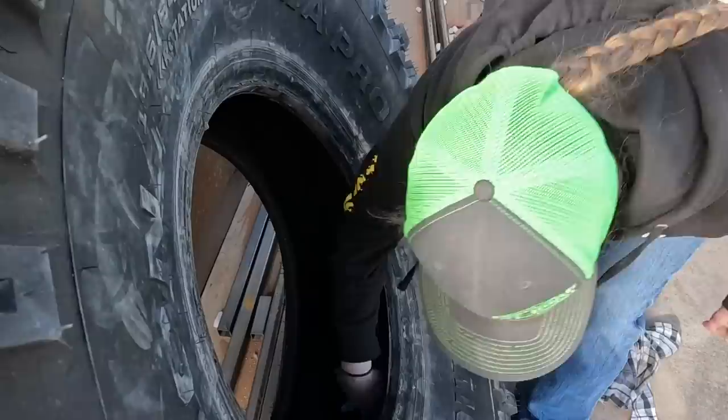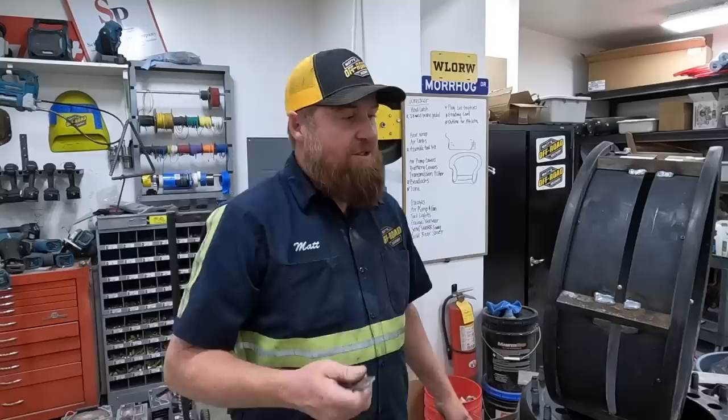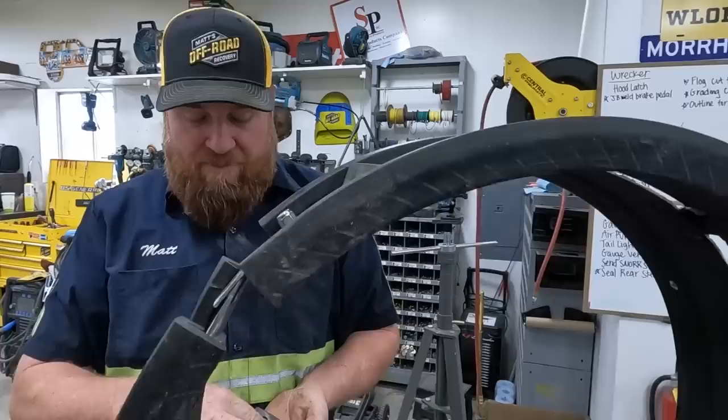Inventory's got to be loaded. Jody will be in to help with that later today. Get that big tire up there — I need both beads cleaned and all the water out of it. Got all the water out, just put some rags in there and soaked it up. So since these bead locks were for a different wheel — we had to make them wider and we've got to make them slightly bigger around. This is the original strap, this is the new strap. This lets us make them the right diameter for our application. It's not rocket science — it's wrecker science.